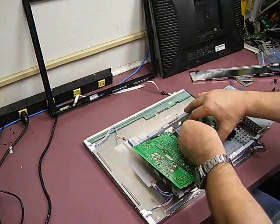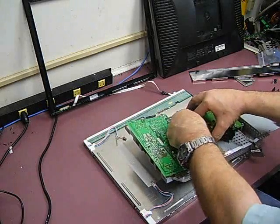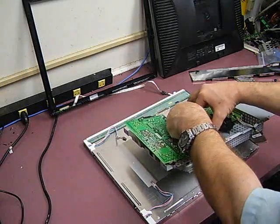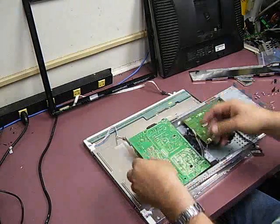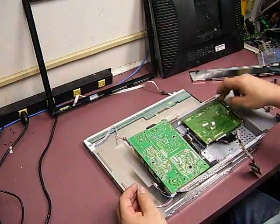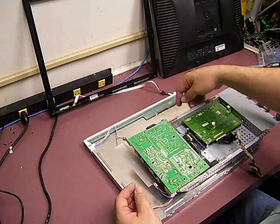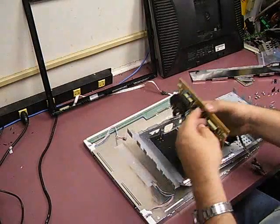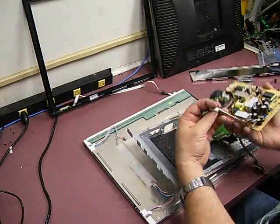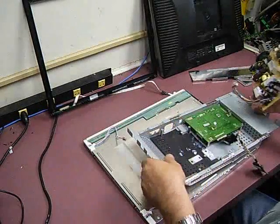We have it unscrewed, so you can just lift up a little bit on that CPU board and plug it in. If you don't want to deal with that, there are a couple more screws on it, and you'll need to undo the screws on the VGA and DVI connectors, then you can just remove the whole board. Whichever way you prefer, both will have the same end result.